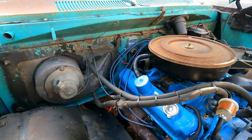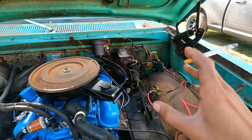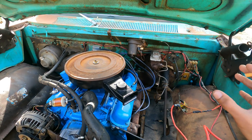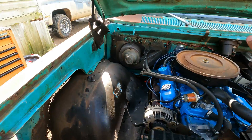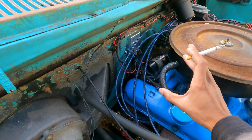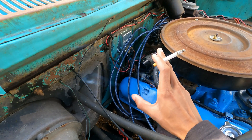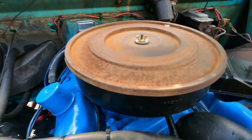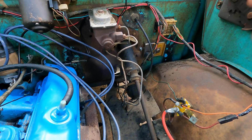What I did was remove the ballast resistor entirely. When you switch to this system, most cars with this box have a four-pin ballast resistor, but I wanted to do away with all that. The whole purpose of the ballast resistor is to regulate voltage so you're not cooking stuff, but that also works in conjunction with the coil. So what we did was swap in a 12-volt coil — a Flamethrower, Accel, whatever — they all work.